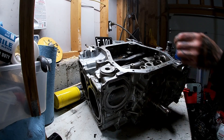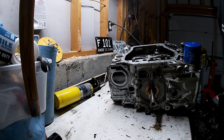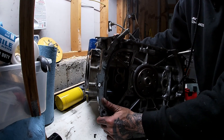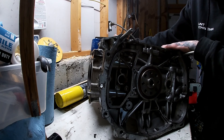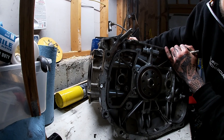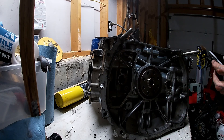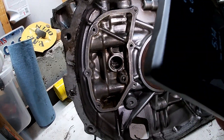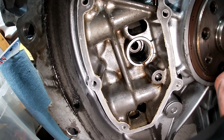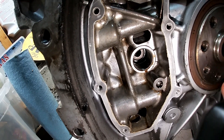Looks like I already took off the two in the front, but you can see there's one there and one there. Now we can go ahead and get these wrist pin clips out and get the wrist pins out and get the pistons out. I just put a crank pulley bolt in the crank — got a 22 millimeter wrench — so that I can rotate it. We're just looking for enough rotation to where we can see through the hole to the wrist pin and access the wrist pin clips. You can see the wrist pin in there and the little clip, so let's get a pair of needle nose pliers and pull that clip out.